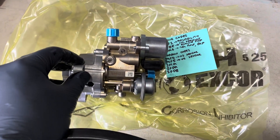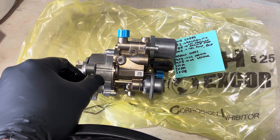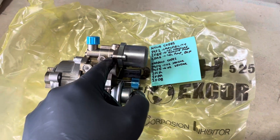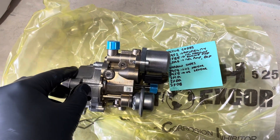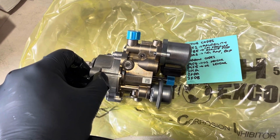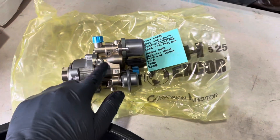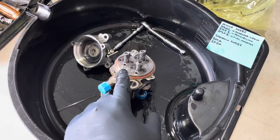The driving symptoms were quite different with the external leak. It was almost instantaneous loss of power - not even 400 psi of rail pressure. My rail pressures were more around 60-70 psi, which indicates the DME had stopped sending the pulse width modulation and had basically given up trying to control the high-pressure fuel pump, just letting the low-pressure fuel pump bypass pressure through to the rail. I couldn't drive the car at all - the engine was shuddering and shaking and it wouldn't idle. Whereas with the internal leak, it was still idling, but as soon as you applied power it would throw a fault code and go into limp mode.